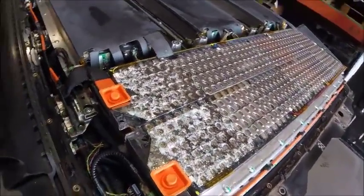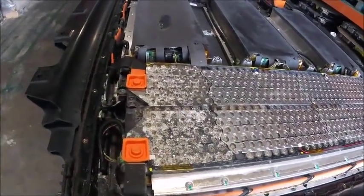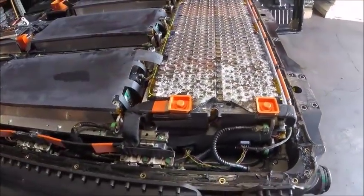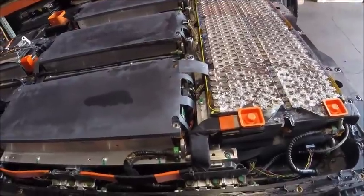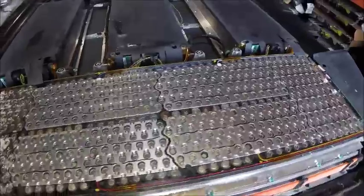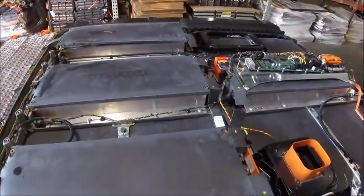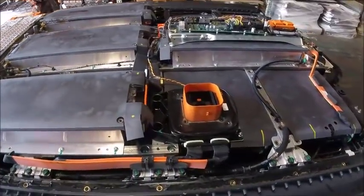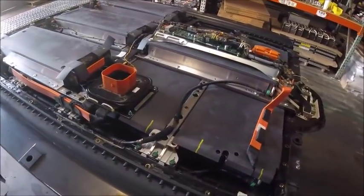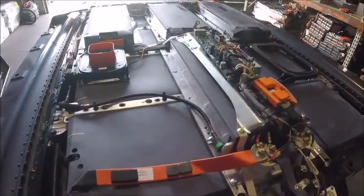So obviously we now know there's water damage in here. I read the voltage of this module, and it was at 6 volts total, and it's supposed to be around 24 in that range. So far this is the one that's affected the most. Obviously we can't really get into the rest of them just yet, but the voltages of these smaller ones were at 18 volts each, so that's looking promising. But once we get them apart, we'll check the contacts, see if there's any corrosion like that other module, and see what goes on from there.